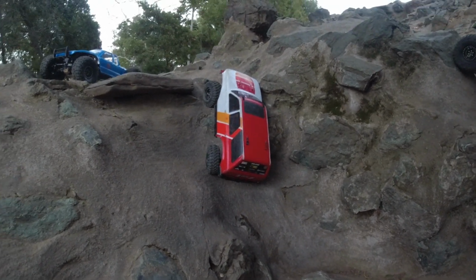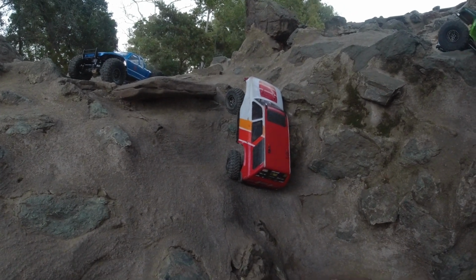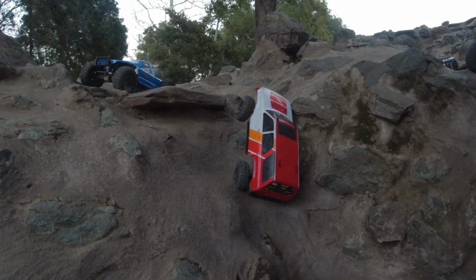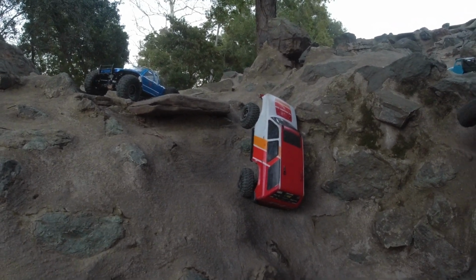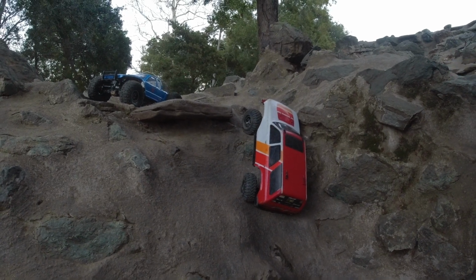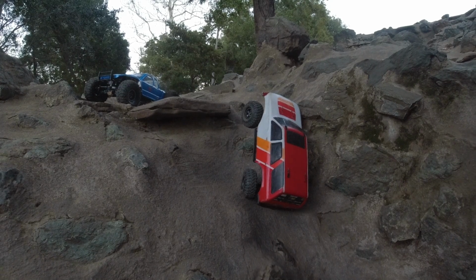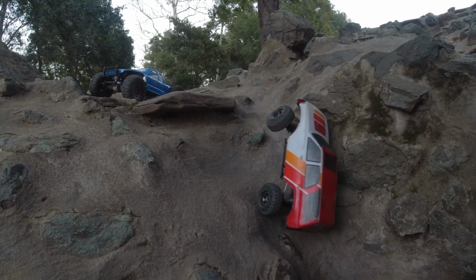Right? Yeah. So you might want to check, have you checked your weight distribution? Yeah, right now I have all four wheels weighted equally. I mean the whole rig. Did you do a weight distribution on it? Like a 4-point? Yeah. I haven't done that. Okay. Because right now, I would say you're not at 60-40, and that's one of the reasons you're having issues. Okay, so you might want to do a check.